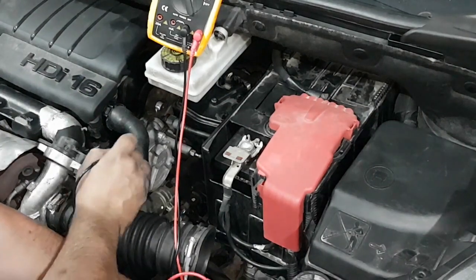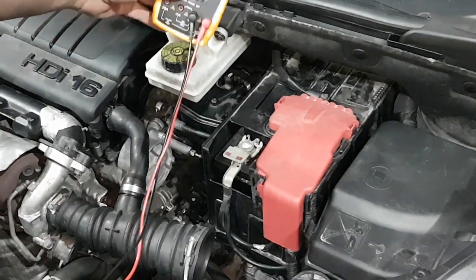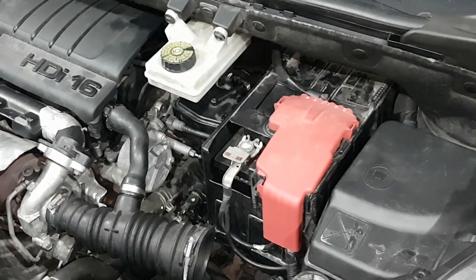I've just run this engine once. Before I ran it, they all read around 1 ohm. As long as you have a pretty low resistance you can say the glow plugs are alright. Even in the kilohm range they'll still function, maybe with diminished performance, but as soon as you start reading megaohms it's time to change them. Thanks for watching and I'll see you guys next time.